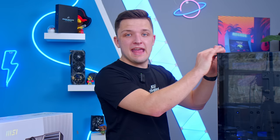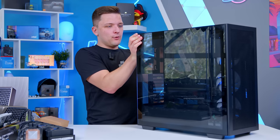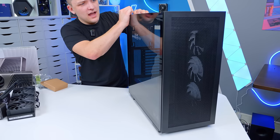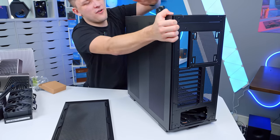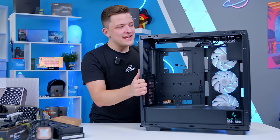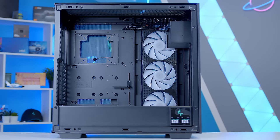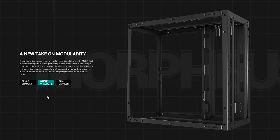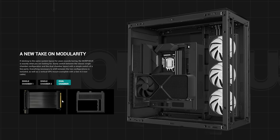Doing this now makes everything way easier. This is the Deepcool Morpheus — and it is a bit of a beast, incredibly heavy at 15 kilograms. Continuing the theme of giving Deepcool a go with high-end components. With a large tempered glass side panel, a mesh front panel, and a large rear perforated back panel, it's hyper-modular, hyper-customizable, and certainly not for the faint-hearted. It's got three 140mm fans included as standard on the side in an exhaust configuration. The motherboard tray is movable, so you can turn this into a dual chamber case. Honestly, it's one of the most complicated chassis I've ever used.